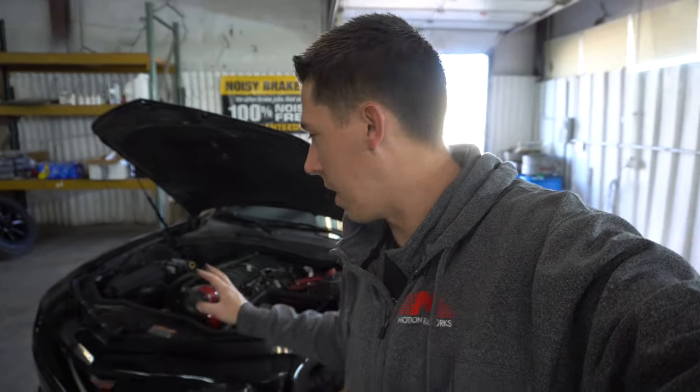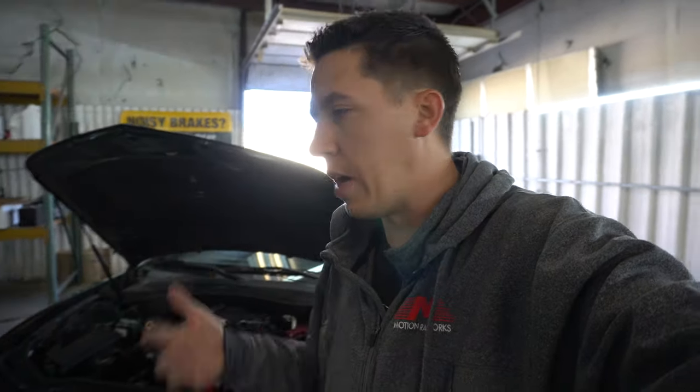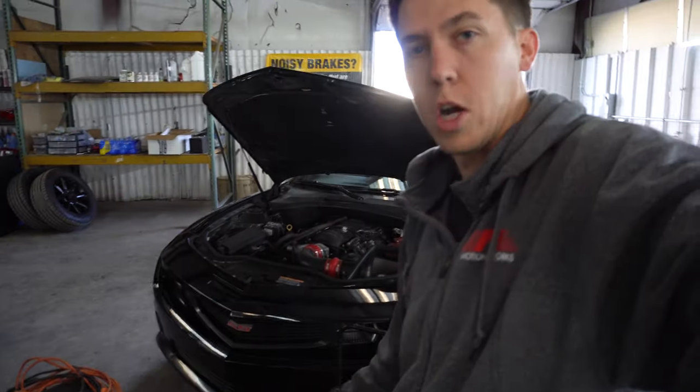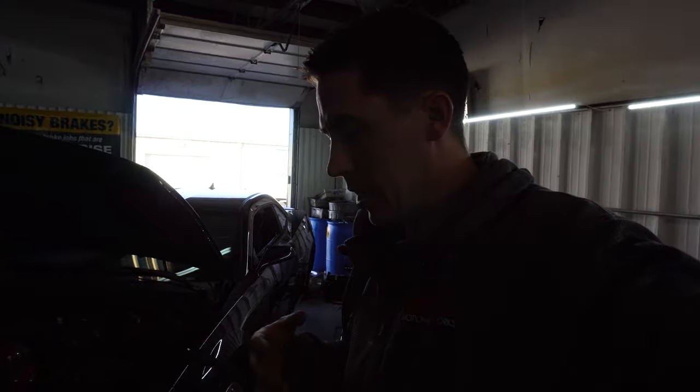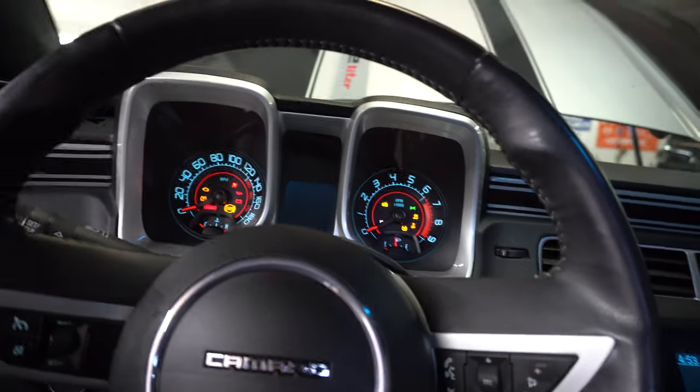Something to note when tuning cars: if your battery is not in really good shape, it's really hard on batteries because you're loading tunes and driving very little. There's a lot of key-on time but not a lot of driving time, especially at RPM — just some idling, you make a pull, then it's over. Got the battery charger hooked up — shout out to Jamie, he had it sitting here ready to go. These are little things I'll learn I need to have around the shop. I'd recommend: if you're getting ready to have your car tuned, throw a charger on the battery the night before.